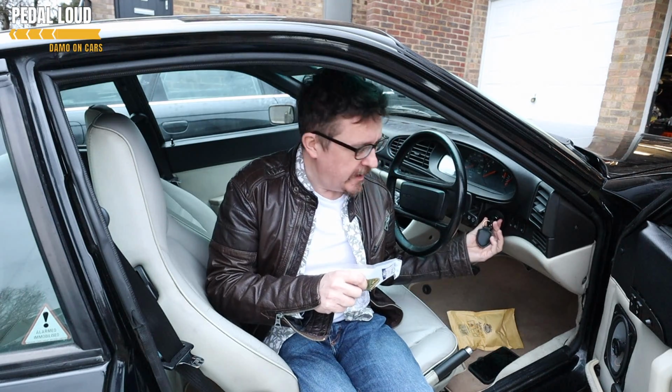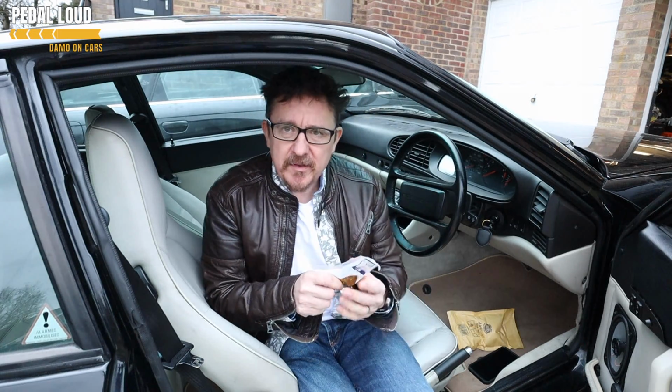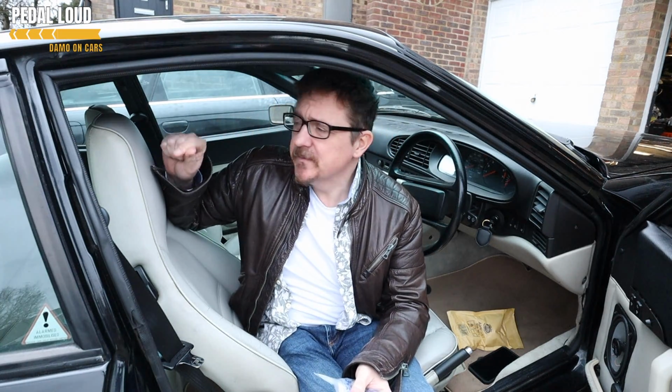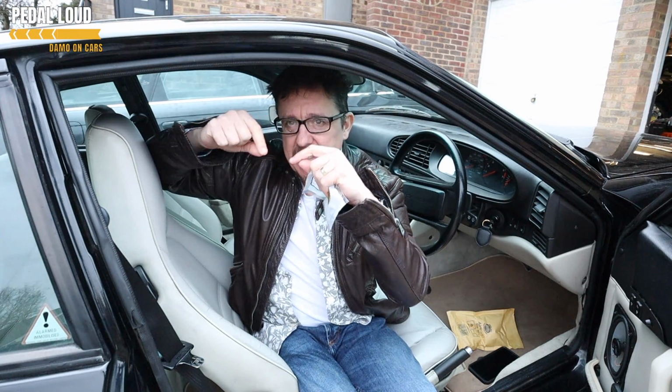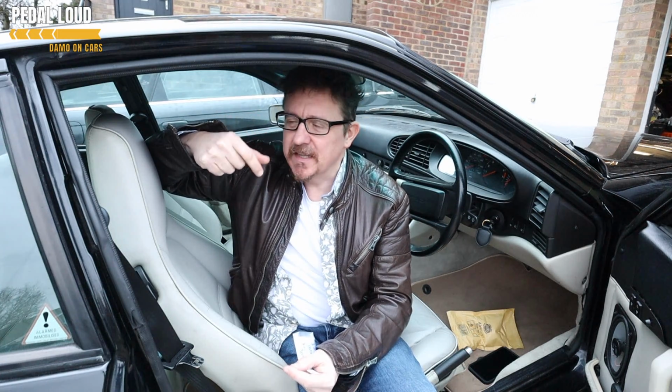So there's various operations that you do with the sunroof, but in the accessory position, if you push the up arrow there, the arms should retract in and stay down, and then they should just stop. What happens is there's a bit of resistance, the cogs turn, the bar goes in, and there's a clutch that spots that resistance and stops turning. What happens over time is that the tension in the clutch increases, causes a problem, and the actual bars, the pegs with the little grips on, we'll see those, shred the plastic gears in there. And I think that's what's happened here, because it's just not working right.